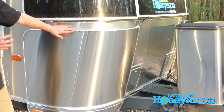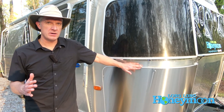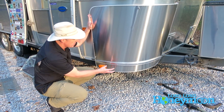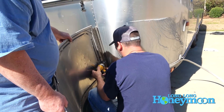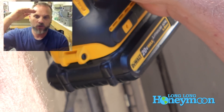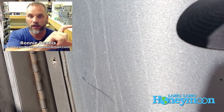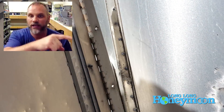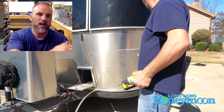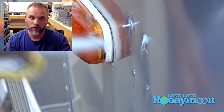Here we have the new aluminum rock guards - these are the 2020 style. They're a little different from the rock guards originally on our Airstream in that they extend up a little higher on the front of the trailer. First thing we had to do was remove the old ones. Because the newer rock guards are about eight inches taller, the brackets attached to the side of the trailer didn't match and didn't line up. We had to remove just the top bracket - the bottom bracket we were able to reuse - because the top bracket for the old shorter rock guard was too low.